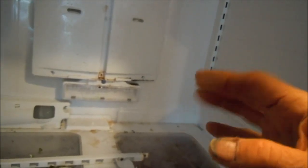What I'm going to do is work on the back and look at the back evaporation tub, make sure the drain orifices are clear. Meanwhile, just let this thing defrost a little bit on its own so I don't have to rip it apart.